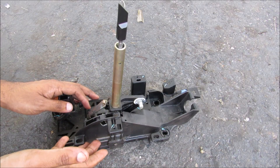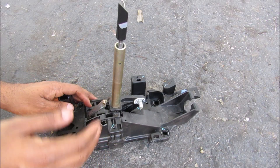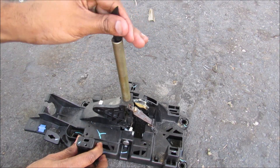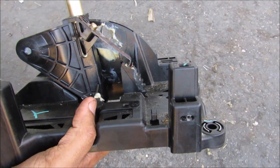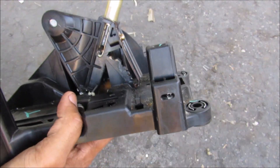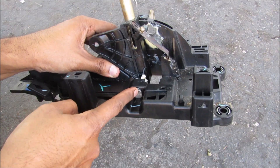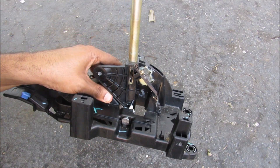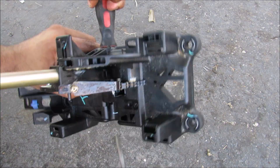The remaining part of the shifter — the mechanism that protects the transmission — is purely a mechanical mechanism. We've got the shift lever here with the detent rod. Over here we've got the spring plate that has grooves that position the lever in the exact gear that you're going to be in. And then we've got the control shaft, which is the main pin that runs through the bottom where the lever pivots on. I'm just going to use a screwdriver to remove the control shaft, then unscrew the spring plate, and now I can remove the shift lever from the base.